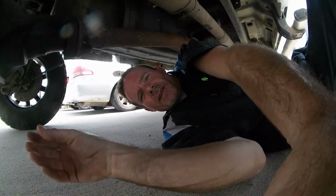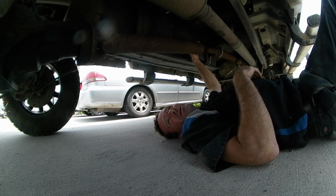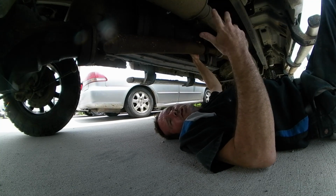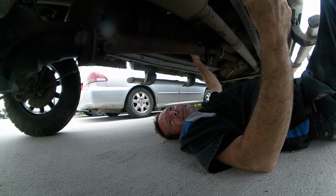So when we take that driveline off, you might chalk up a pinion seal, and then depending on the miles that are on the truck, if there's 100,000 miles, I do rear diff service too, because there's no use in adding fluid to dirty stuff. You might as well take the cover off and clean it out, because the rear end should not lose any fluid at all.